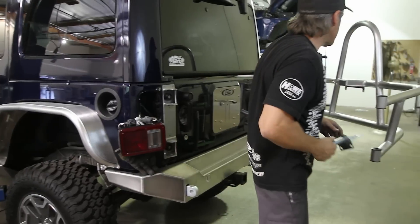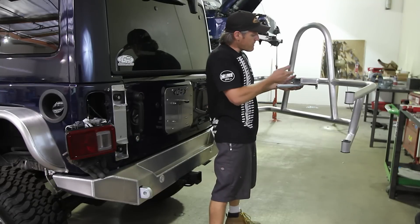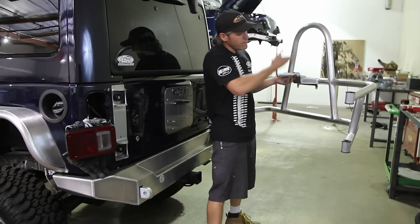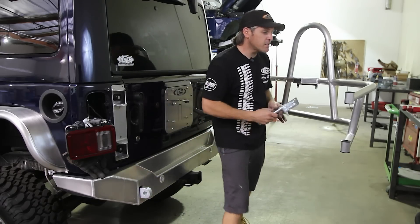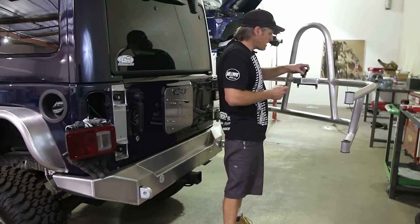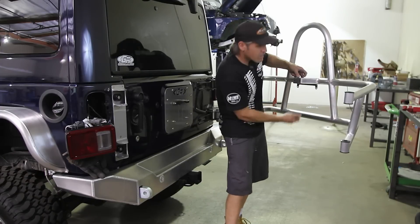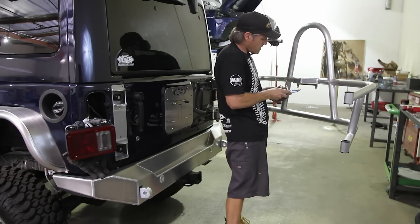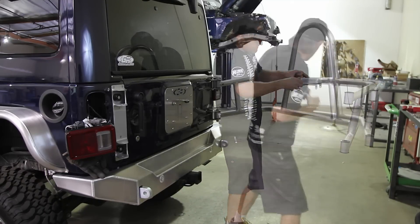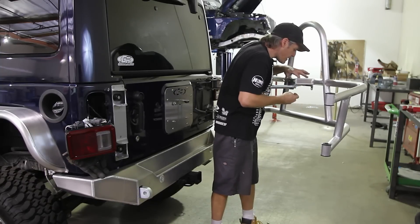The spare tire mount piece locks in here. For a 37-inch tire and down, mount on the bottom of this piece. For a 40 or 42-inch tire, mount it on top — because of the sheer size, the center needs to raise so the tire doesn't hit the bumper, which is why our bumper isn't designed for those larger tires. These pieces come with a clip nut. Feed through the circle hole on top or bottom, bolt it in, get all three pieces and all six bolts in, then tighten them down pretty tight.